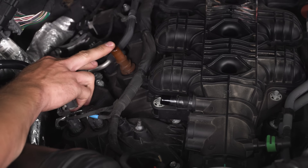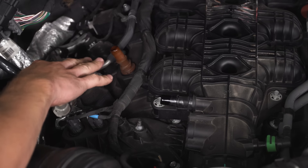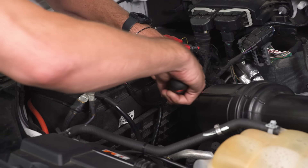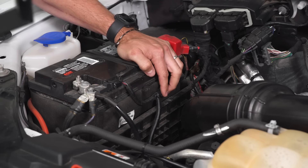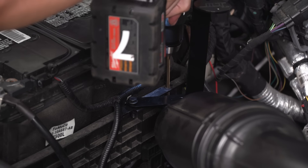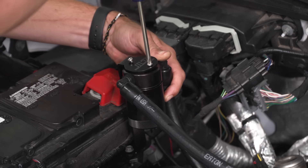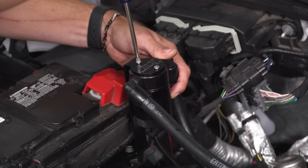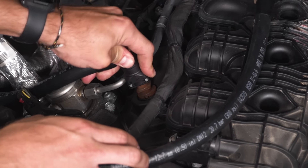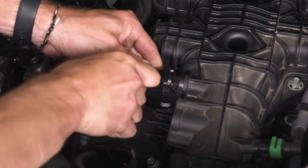This is our PCV valve — a one-way check valve that allows air to go in but doesn't allow that air to come back and re-pressurize the crankcase. We're gonna make way for the JLT bracket and to do so we have to remove this little Christmas tree clip near the battery box, because that's where the bracket is actually going to mount. JLT does supply a bolt-in clip that you can drill into the battery box to really secure it. With our bracket in place, we bring in our JLT canister. With it physically mounted in the engine bay, we can plug everything in — pretty easy, just pop it in place and route the hose around the intake tube.